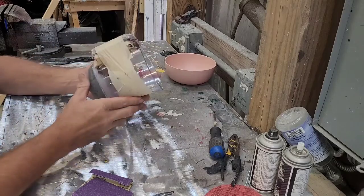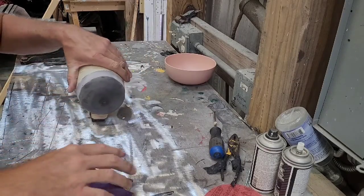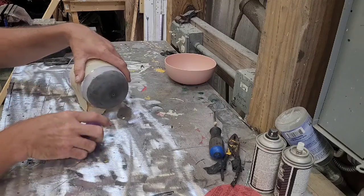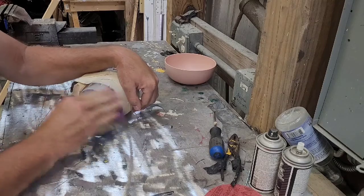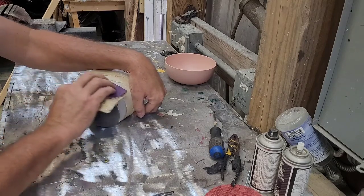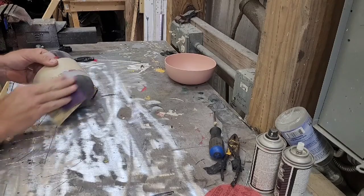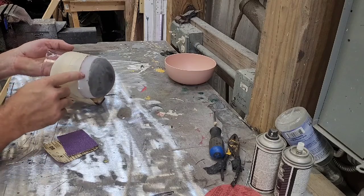The reason I put the tape and wood back on here is because at one point when I was sanding down the top, I wanted to make sure I didn't break it by pushing down on it. So I just put that back in there temporarily while doing that — it'll obviously come back out. Anywhere you're going to do your filler, you've got to make sure it's roughed up. The whole area right here I'm going to have a little bit of filler that flows down, so I want to make sure it bonds really good.